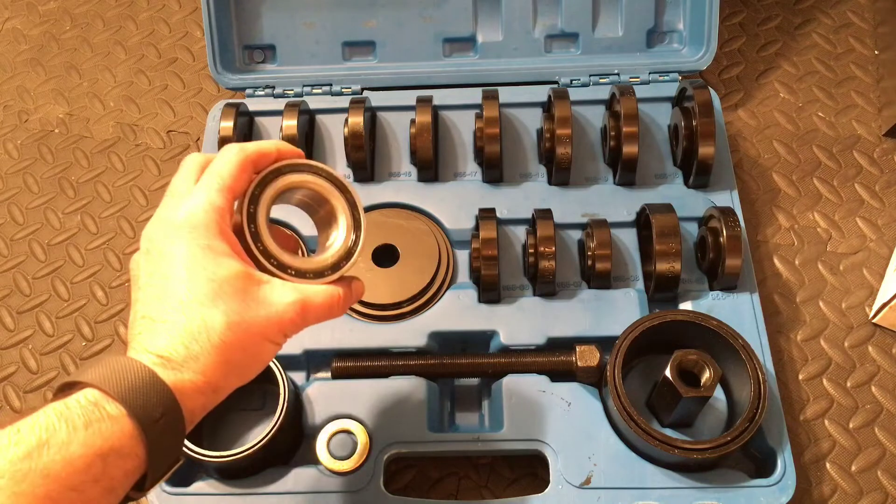I went ahead and connected the 32 millimeter socket to a breaker bar, then I have the 27 millimeter socket on the other end with the ratchet holding it all together. Basically you're going to secure that end and then tighten this tightening nut to get that to move. What I'm going to do though is use this 120 volt electric impact wrench — it's not a very strong one, but it's a lot easier than tightening with the breaker bar. You also want to make sure that the attachment you've selected is wide enough to receive the bearing so it doesn't get stuck in the process. Make sure you measure that right and have the correct one.